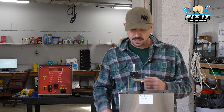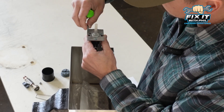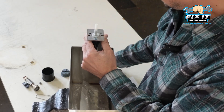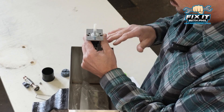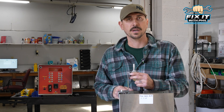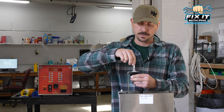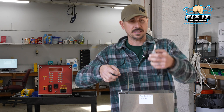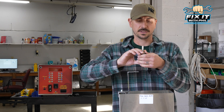There's the magnet, magnet spring. There are three screws holding the 506 onto the mounting bracket — remember that when you take those screws out, the entire valve assembly will be loose. This is where it can get tricky and small parts could drop into the bucket. A piece of cardboard over the soap bin is a good trick. At this point the valve is loose; I'm going to push on top of the bonnet and push the entire piece down through.